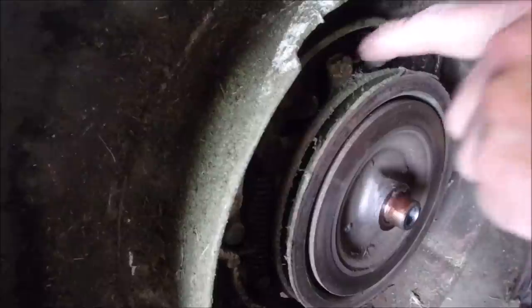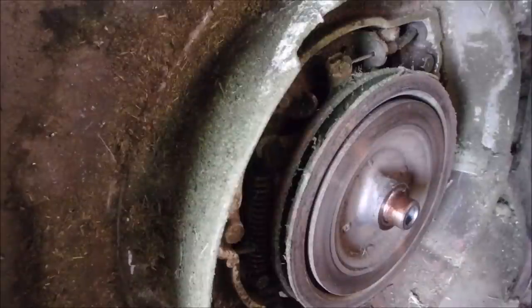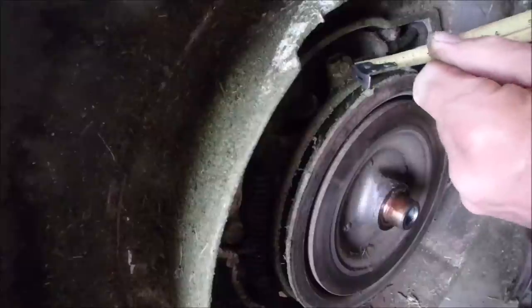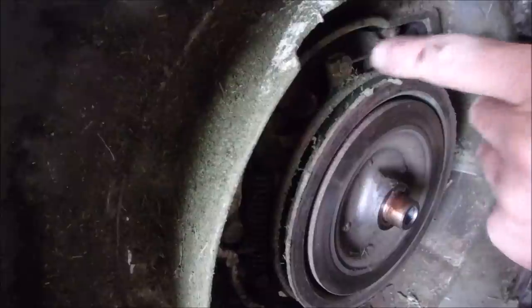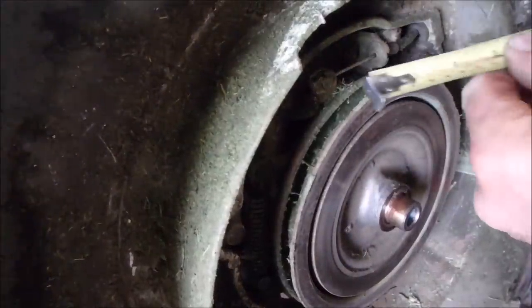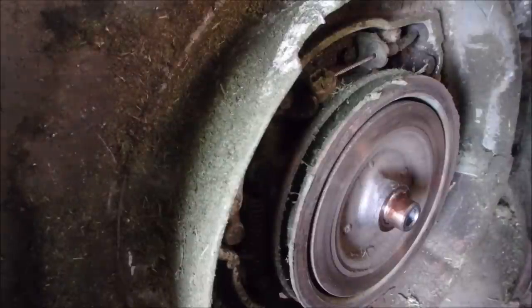I should have measured before how much distance we had there. I guess it'll be back to where it was, so let's just measure that. Sometimes I use metric and sometimes I don't. To the center of the cable ball to the origin of the cable conduit is one inch even. And now it is one and three quarters. So it's moving three quarters of an inch, and before I knew it was only moving a quarter of an inch. So I get an extra half inch of movement there.